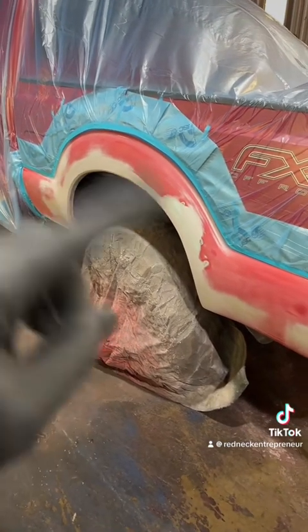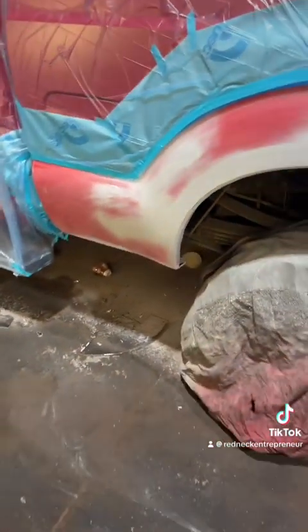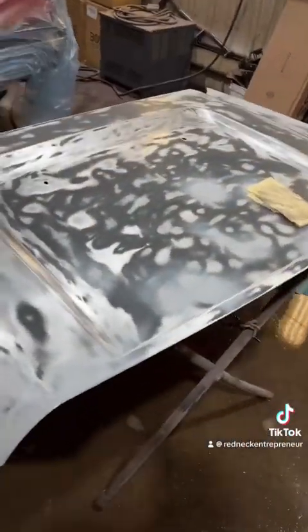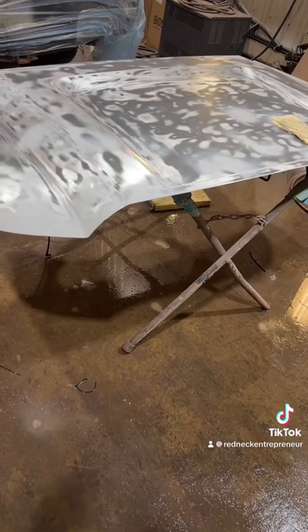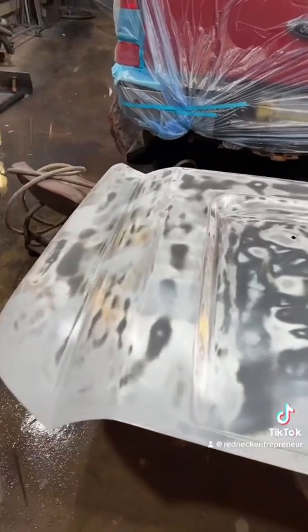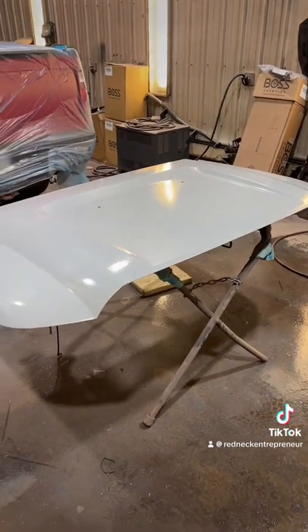Getting ready to spray my sealer - got all this prep done and ready to go. Had a couple little dings and chips, the rot hole, and a couple more dings. This I was not expecting to take all the way down, but it had so many rock chips that by the time I got it all feathered out I was 80 percent sanded anyway, so I went ahead and sanded her down almost the whole way. Patched a couple spots, blocked her out, and she's ready to go. Going to spray some sealer, then block these down in the morning and get some color on.